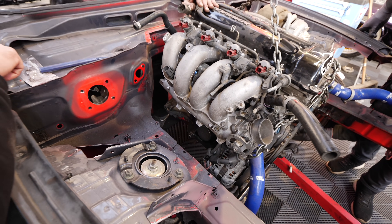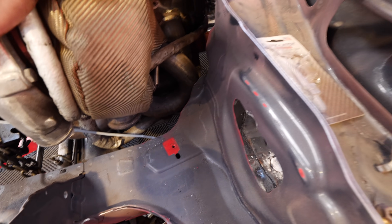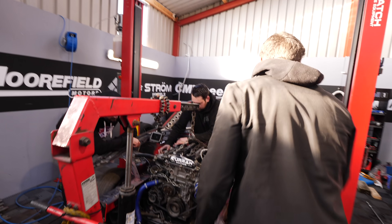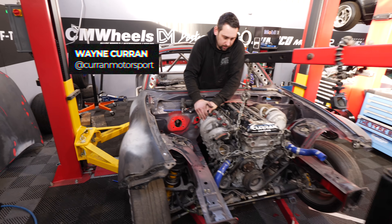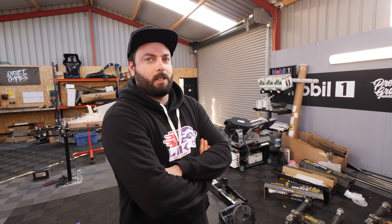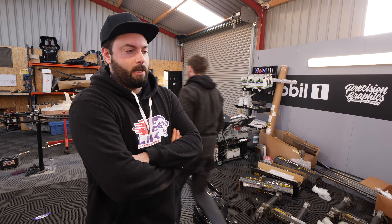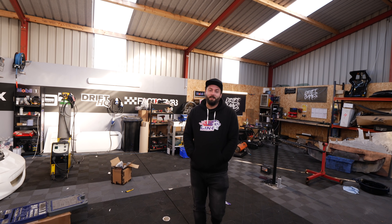So now the sump is the least of our worries. You've got stage two of absolute misery. The engine is scraping the manifold. I feel there's more cutting to be done. It's focused on everything - the steering column, the power steering lines, the back of the bulkhead. We can trim the bulkhead, I'm not too worried about that. I think he had so much concern about the sump, the turbo, and the manifold, and now the worry is actually the steering. The good thing is it's in the car. It's getting it fitted that's the hard part.